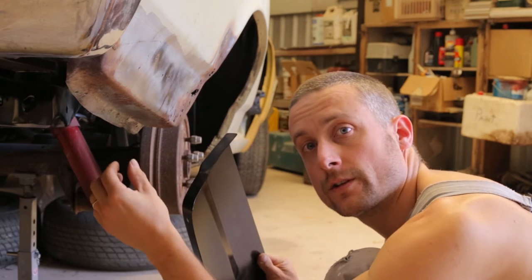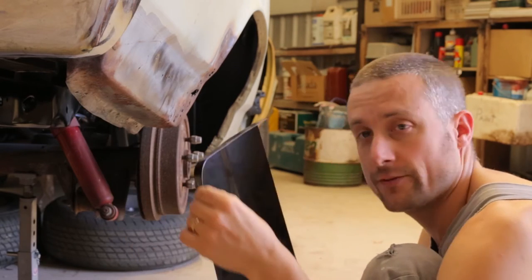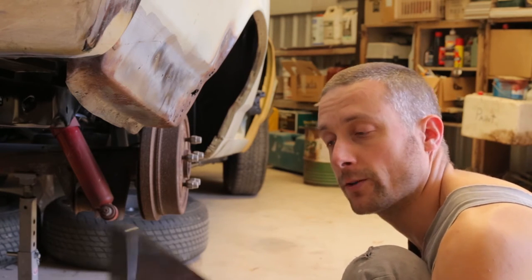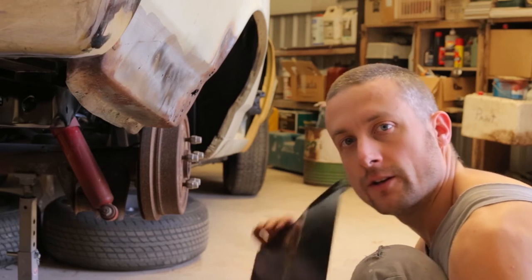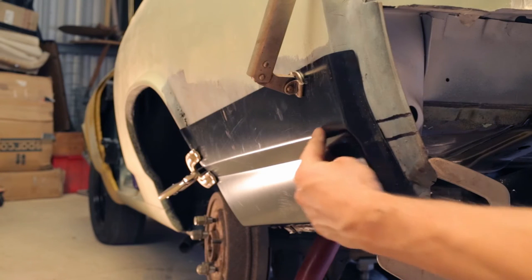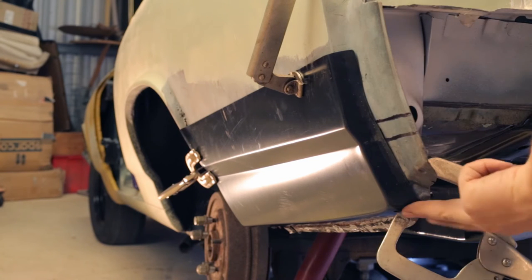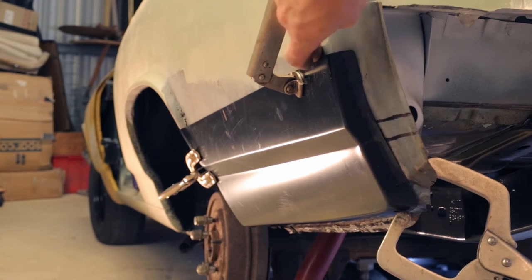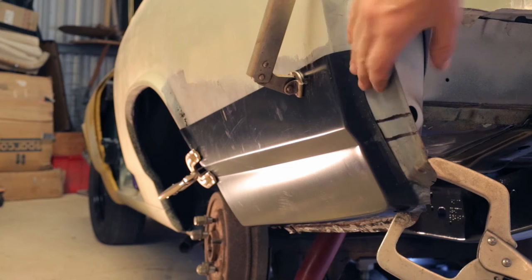I will plug weld my patch onto the inside panel as the factory joined it here, which means I have to put an extension on this thing that costs nearly a hundred dollars and a lot of money to ship across to Australia. It's going to be almost as much work fitting this as making it. These creases — which is really what you're buying here — are lined up with where the factory steel is, and I've cut just enough steel away around it so that the bottom part of the patch can clamp in where it needs to be, overlapping the rest of the quarter.